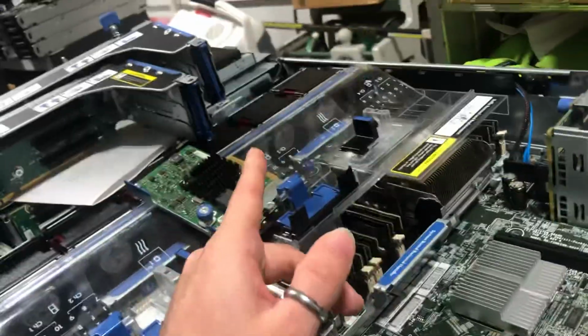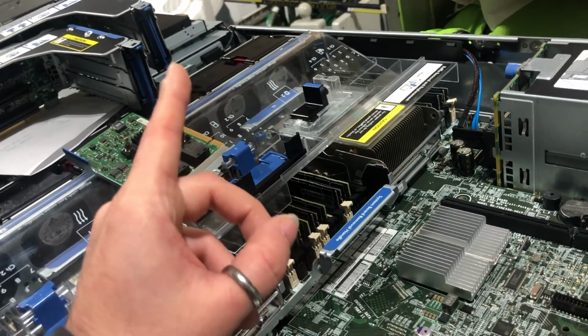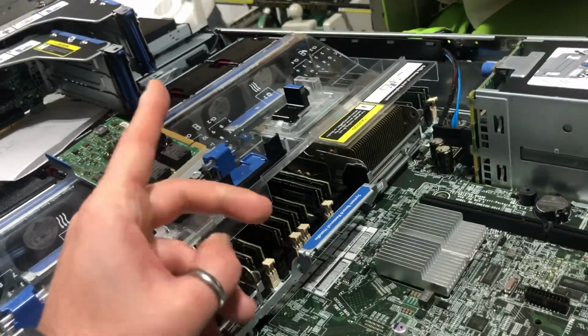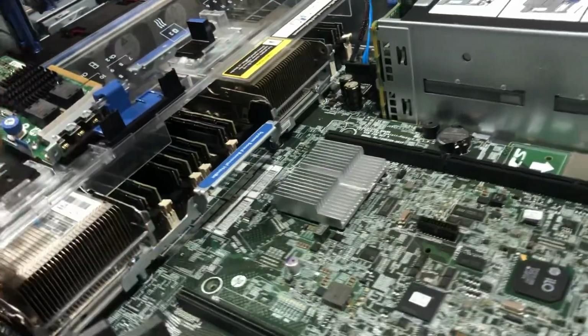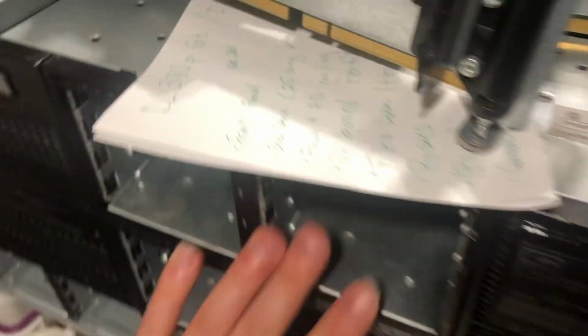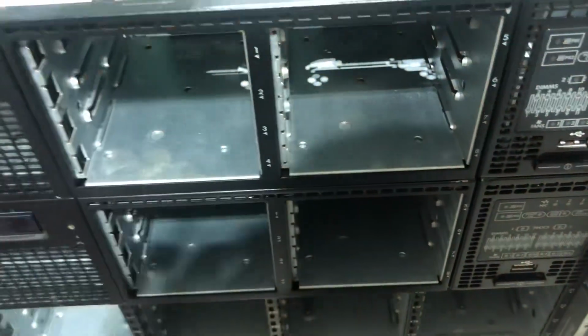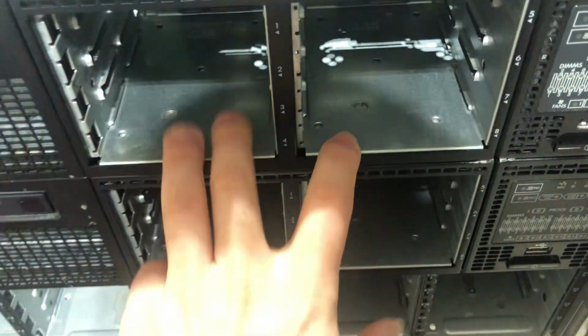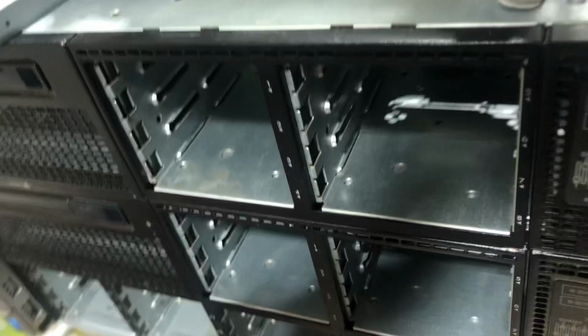The front disk, the one that you would be replacing your DVD drive with for an SSD, for example, works directly off of the SATA chipset, and the hard drives or SSDs that would be in your front bay are what's going to be directly connected to the SAS controller.